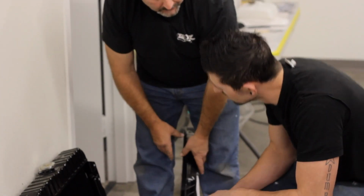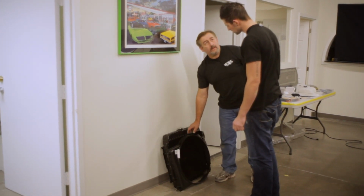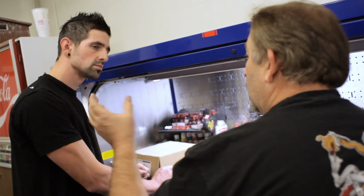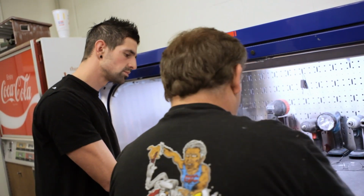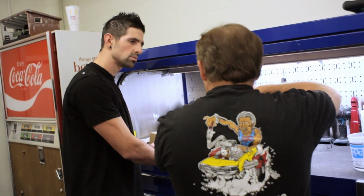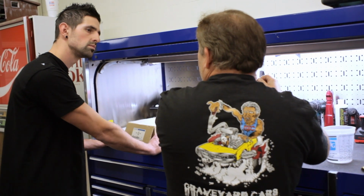There's probably 10 or 15 radiators that would bolt in, but only one of them is going to be the right, correct part number. The car was built in August of '69. Right. We know that from the door VIN label. We know it from the fender tag. Right. So we know that every part that goes on the car has to be preceding it. It can't be past it, but it can be preceding it, just cheating by like 2 years or 3 years.